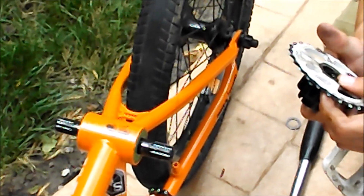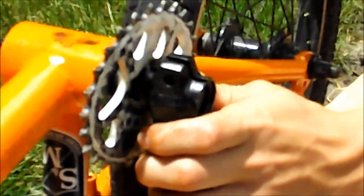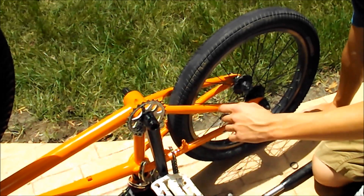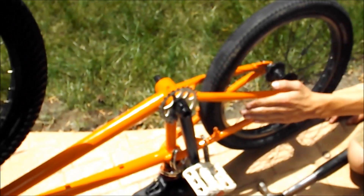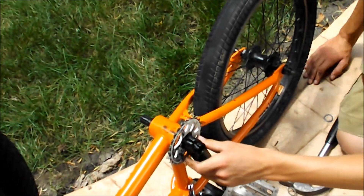He's a right-hand drive. We already took off the sprocket. We couldn't get off the chain, so we didn't take off the back wheel. You're going to put this crank arm on and it's not going to line up obviously unless you're lucky on the first try. You want it to line up perfectly with your driver. If you don't line it up perfectly straight, like on my bike — I didn't have mine straight for months and the bike shop acted like they didn't know what was wrong. That's why my chain was always loose and breaking. If you don't have it straight, your chain is going to bend and break eventually and cause you to wreck — your bike might throw your chain. So you want to line that up, and if it's not lined up, that's when the spacers come into play.